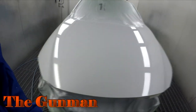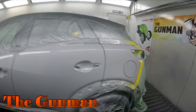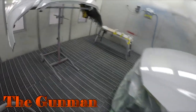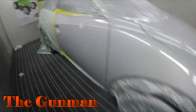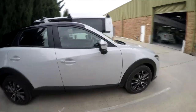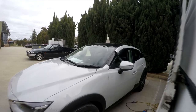It's something I've been putting a lot of time and effort into over the years — to make it look like I've never been at that car. I want to be able to do a paint job on a car and have someone in the industry look over it in a year's time and not be able to pick that I've been there. You don't want shrink back, you don't want de-nibbing marks, you don't want runs, you don't want big sausages on the edges of the panel. I'm going to start writing down some of the big no-nos and basics of spray painting — what you should try not to do. Get those small things right and the big things will come after. But at the end of the day, it all starts with your prep work.